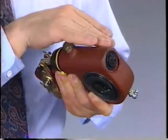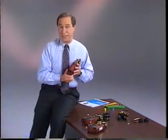There are green and blue pistons used on disc brakes for drive axles. Now remember, there are a couple of other piston applications, so be sure to follow your OEM specifications for correct piston color. Although Rockwell ASAs fit a broad range of truck and trailer applications, this latest housing contour revision allows us to fit even more applications.